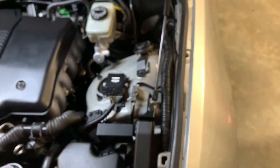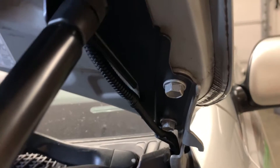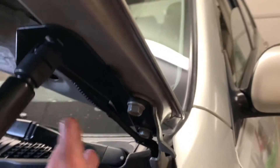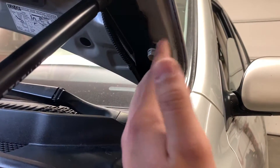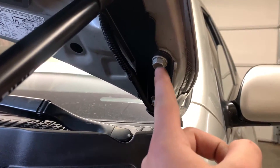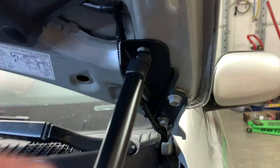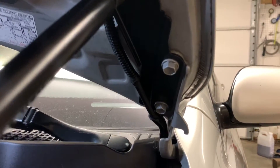Next, you can do the driver side or passenger side first. For this step, go up to the hood hinge and loosen up the top 12mm bolt first — you could also do the bottom. You don't want to loosen both at the same time or your hood is going to basically fall off, and obviously that's not preferable — it's also probably going to throw off your body lines. So just loosen up this top one, get the bracket with the ball end facing out and it will look like that. Note it is different driver's side versus passenger side, so make sure you get the right one.